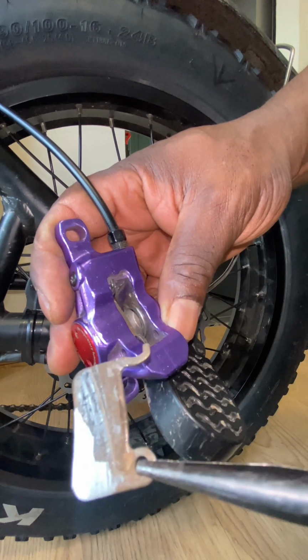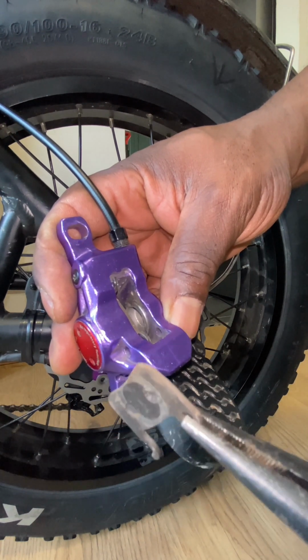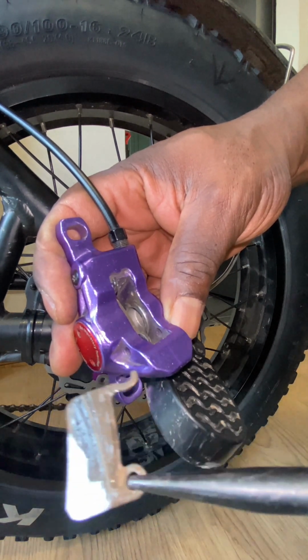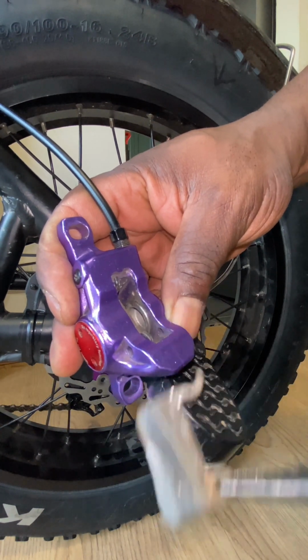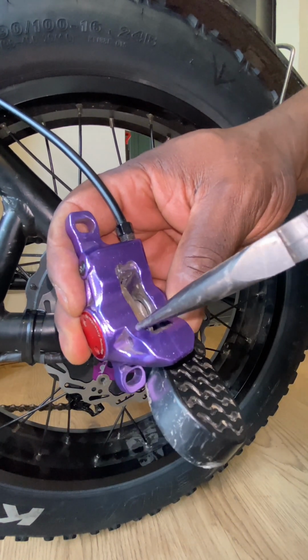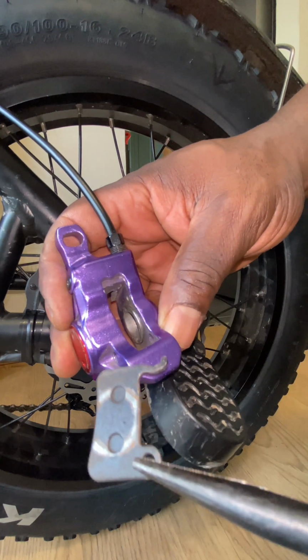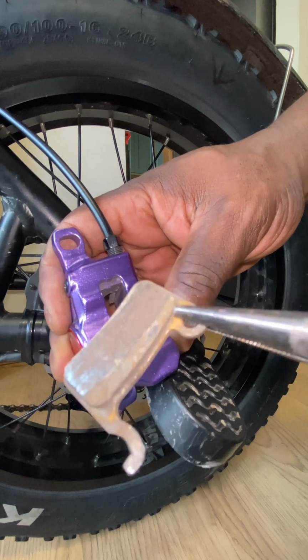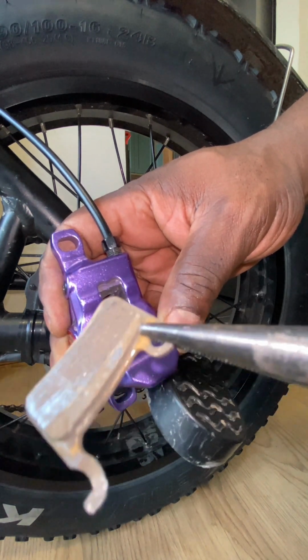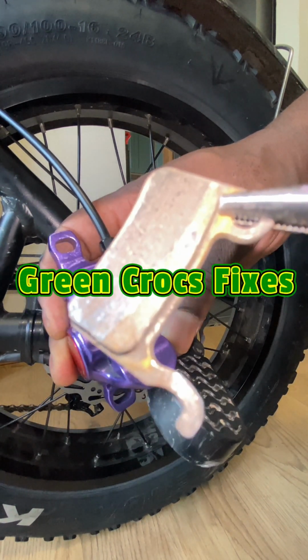Inner brake pad, sorry, you see it's been wearing metal to metal. These brake pads have not been in there 6 months and they've worn out already, and they've been wearing unevenly because the disc was too small. Here's the other one, there's the outer brake pad. Same thing, it's not worn evenly on the disc, and that's why they've worn away so quick.